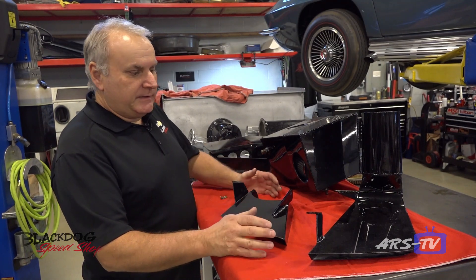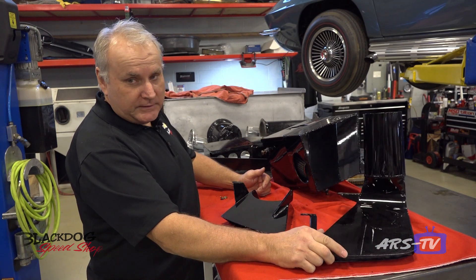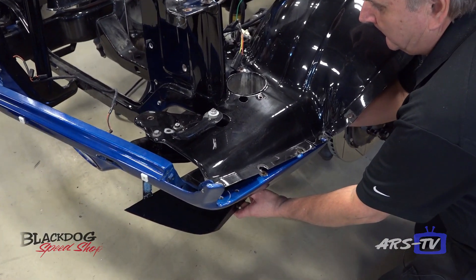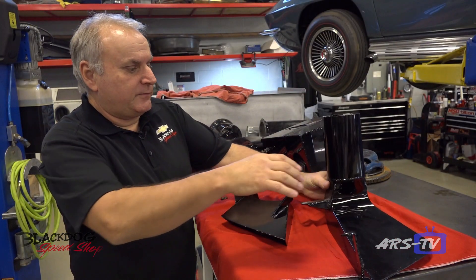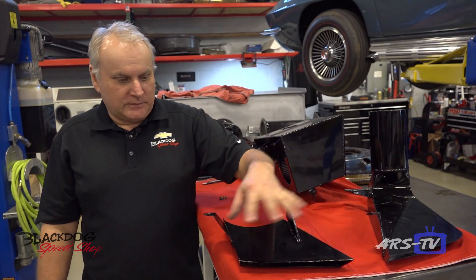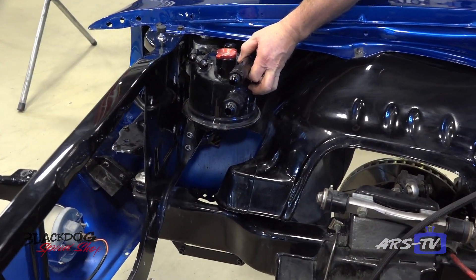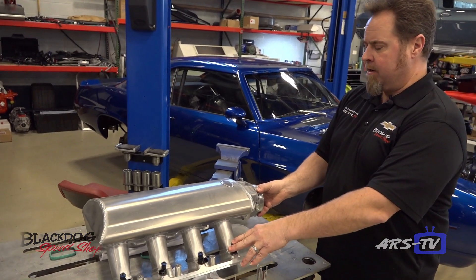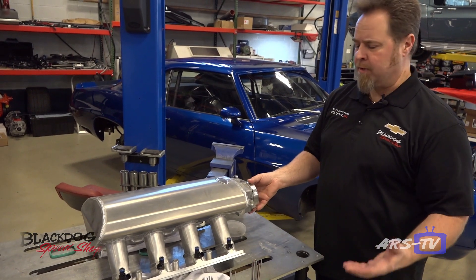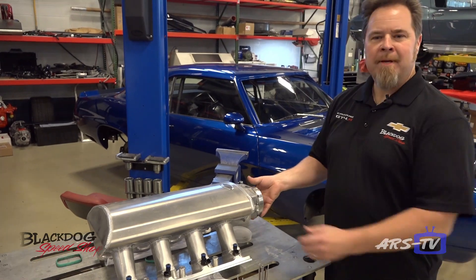What we have here are some of the things that we custom fabricated for this car. This is a cold air ram intake system for the air filter — it fits under the car and goes out the chin spoiler, picking up air and forcing it up into the air box where the air filter sits. We also built a scoop on the passenger side to cool the dry sump oil tank. Here's the custom intake for the 510 — in order to get that 820 horsepower it required something that could really flow a lot of air, with a 92 millimeter throttle body made by Precision Metalcraft.